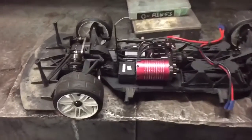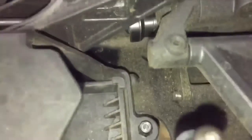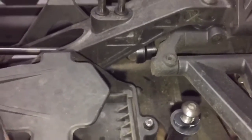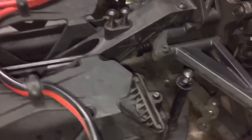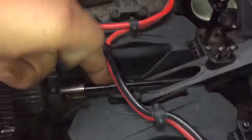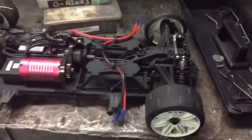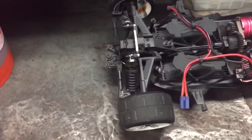Last night I figured out what the problem was. The rear pin — it's kind of hard to see down in here — this is what broke: the rear pin on the rear differential. Now when it spins, the driveshaft does not spin with it. That's why the driveshaft has so much play. Parts are ordered and they'll hopefully be here soon. Let's get this back off and get the driveshaft out of here.